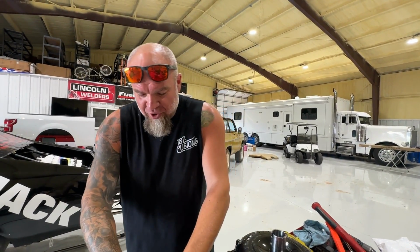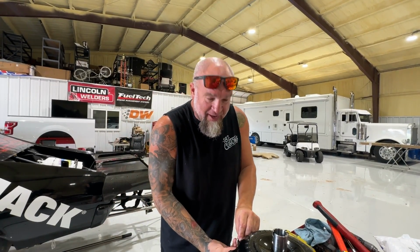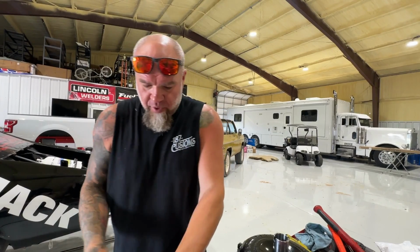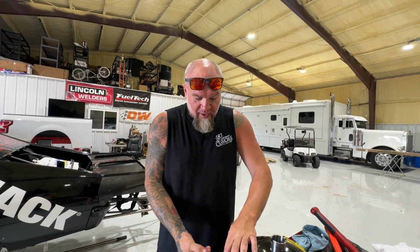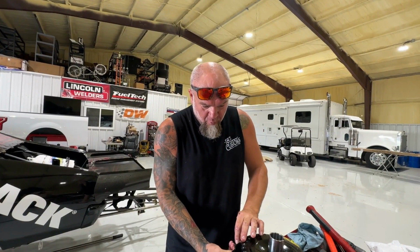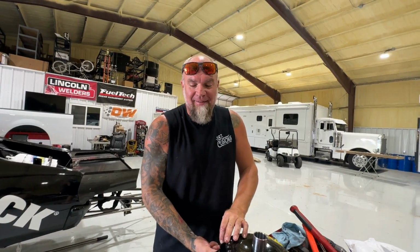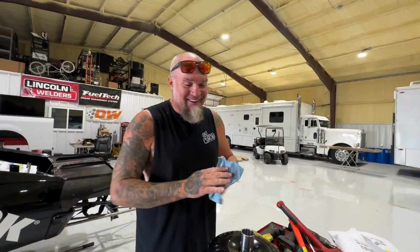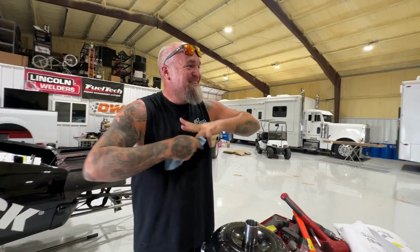And not to mention, I'm sure it's not the greatest thing to leave in first and as soon as you leave, you shift it, because that messes with all your fluids too. A lot of small tire guys run two speeds. Well, we didn't have a two-speed. We had a three-speed. We made a two-speed. It didn't leave in second. So Sean didn't spring for the $200 option to leave in second.